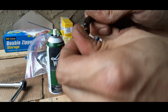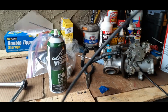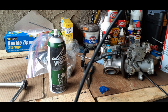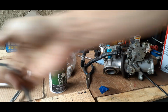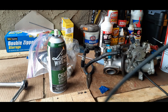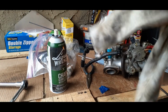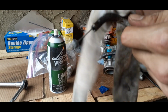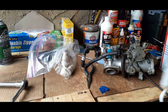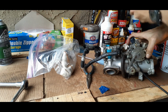And once we get it in there, then I want to wiggle it some, and then gonna pull the throttle. And you just want to make sure that you're getting in there good. And then you're able to clean it. But once we got that part off, cleaned and lubed up and ready, it's going to help our throttle not stick. Put that up. And once we get that good and wiped off, then that's going to go back where it was at originally,